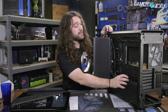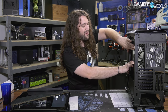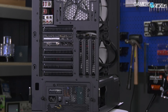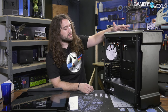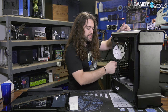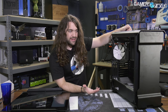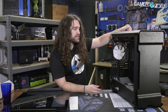The case does do a lot of very interesting things. One of them is the three-slot vertical GPU mount, which allows you to space the video card a bit further away from the panel than typically. As you'll see in the thermal section, you have a 2.5 or 2.75 slot card — probably still don't use it though. Also, if you wanted a top system with a riser, you could route it to this slot and run video out or a capture card there. Unfortunately at $465, they're not including the riser cable — you have to buy that separately as well.